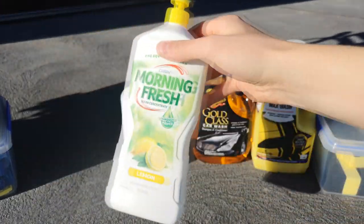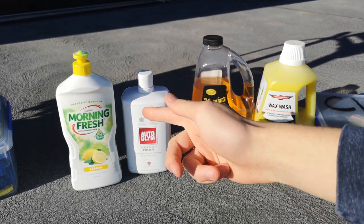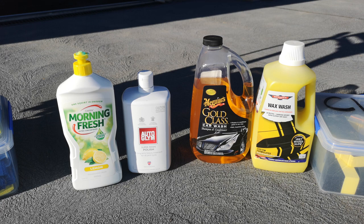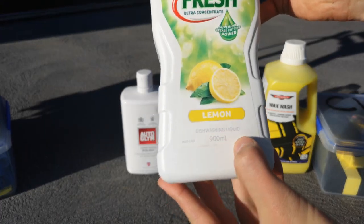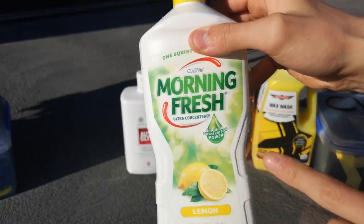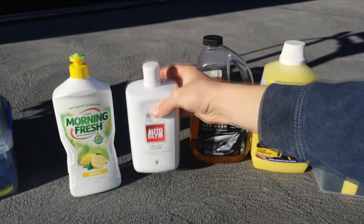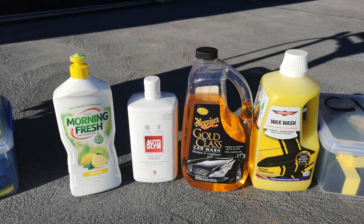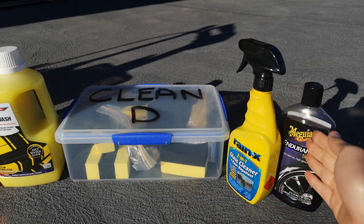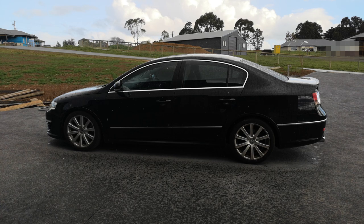Next to that is dish soap. Everyone will tell you not to wash your car with dish soap and I agree — however, in a situation like today, dish soap degreases the paint and breaks down anything on it. It'll remove any polishing, waxing, or coating off the paint and strip it right back to the clear coat. We're using it today to remove road grime, oils, and any waxes still on the paint because we're going to be reapplying a polish at the end. For regular maintenance washes, I'd recommend a standard car wash product instead. Links to everything mentioned are in the description — they are affiliate links that help the channel.